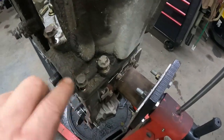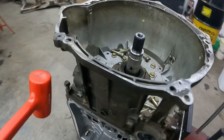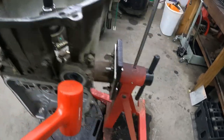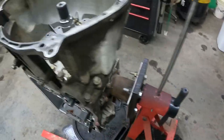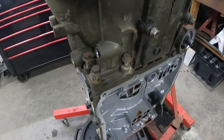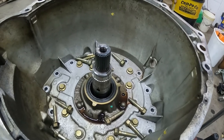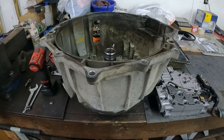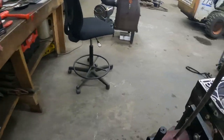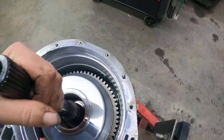There are three bolts here and three right here. Grab a soft-blow hammer and just gently tap going around — don't beat it too hard. We should be able to lift the bell housing off — the bell housing and the oil pump come off together — and then we can get to the first set of clutches. We got the bell housing off. We'll worry about the oil pump later since we're just disassembling right now. The C1/C2 clutch housing just lifts up and out like this.